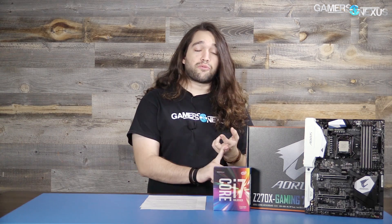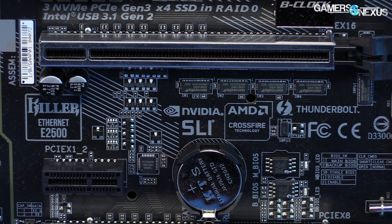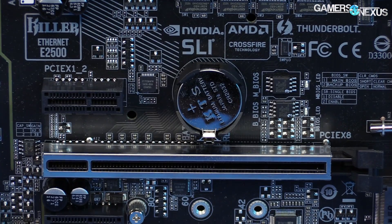The lanes can be shared with things like Gigabit Ethernet, USB 3.0, and other high-speed I/O devices, as the name would suggest. This also includes the capability by motherboard manufacturers, and to some extent Intel, to peel off lanes for additional PCIe devices, up to a cluster of by-four. So you can pull off sets of four lanes that go to PCIe, and that's not necessarily a hard PCIe slot — it can also be M.2 devices and things enabled by PCIe lanes.